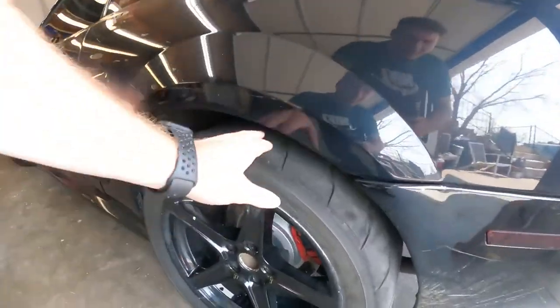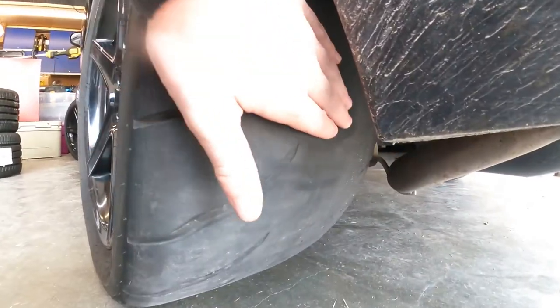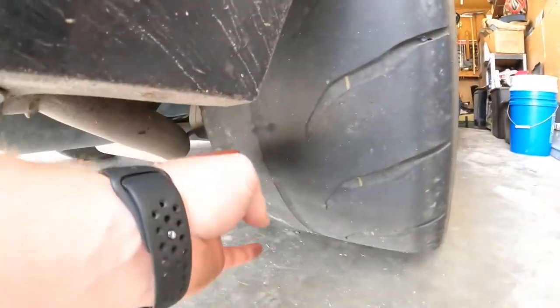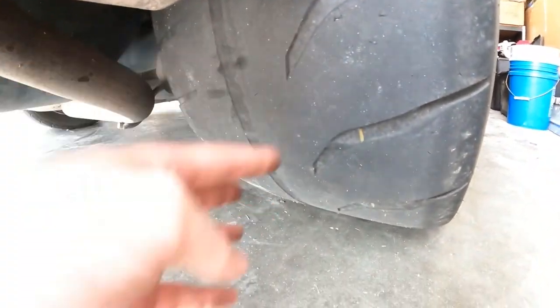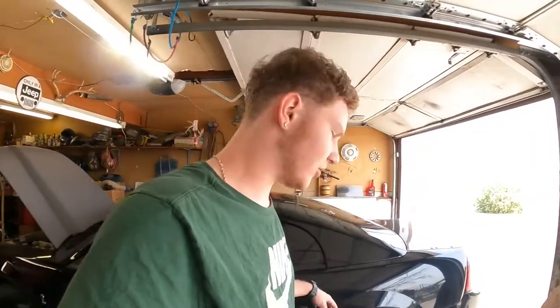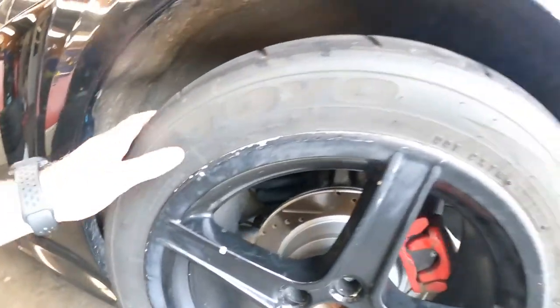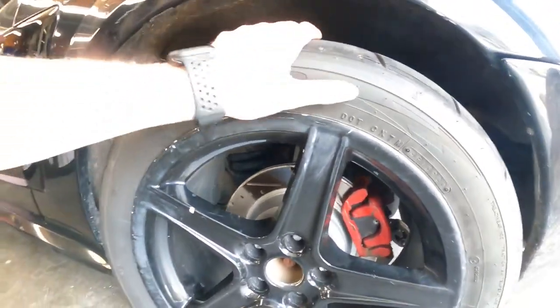One big problem was that the tire on this side has no more tread — no tire wear indicator left right here. I think it was overinflated. You can see the groove on this other side. It was at 38 pounds — I went ahead and took it down to 30, so that'll probably help. These are Toyo Proxes so they're pretty expensive. I don't want to mess them up anymore, and I bet they hook pretty good too.